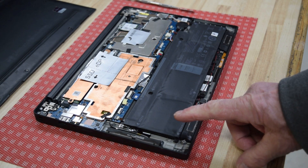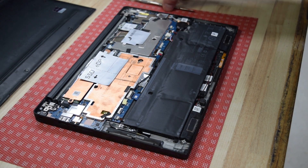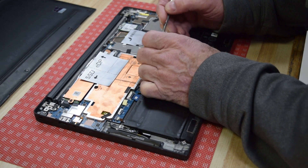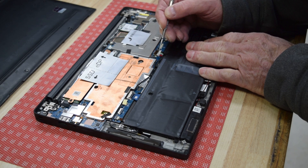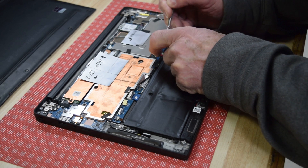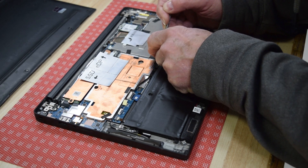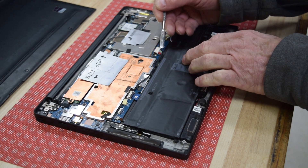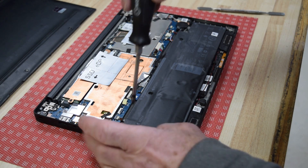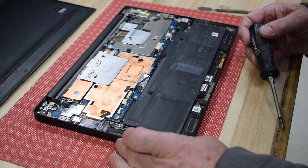You can see this battery is all bulged up — lithium-ion batteries do that. There's the connector to the motherboard. The first thing you have to do is take that little connector; it's just slid in there with no fasteners. You just pull it back and it'll come right out of the socket. That is the connector attached to the battery, and your new battery should have another one of these on it.